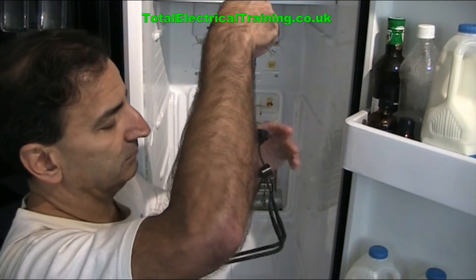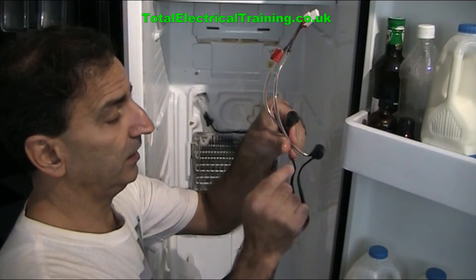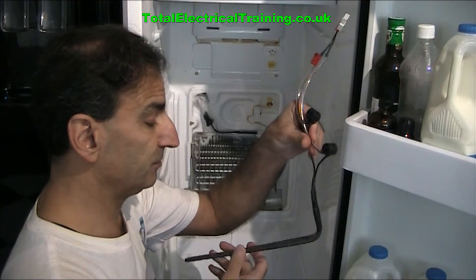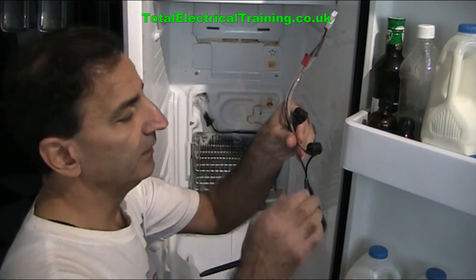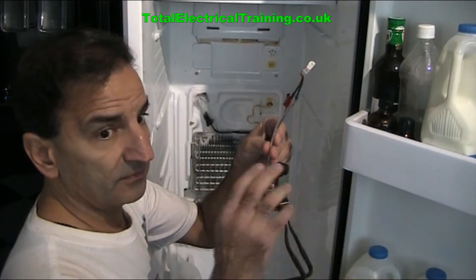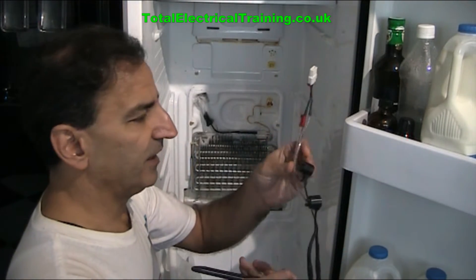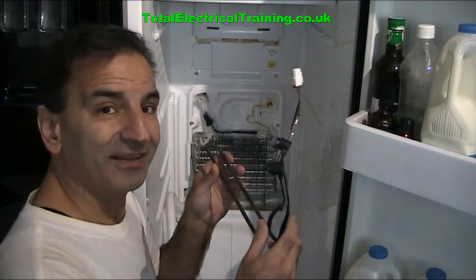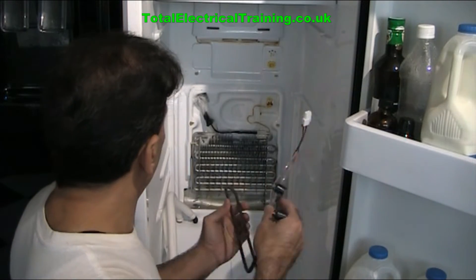The way I tested it was I stripped the wire from here and connected it directly to the socket power, and it turned on — you could feel the temperature rising and see the heat. But when I connected the power through the thermostatic switches it wouldn't come on, and even when I put cold ice on the switches it still didn't work, which tells me the switches are faulty. So I bought new ones and I'll show you how to put them on.